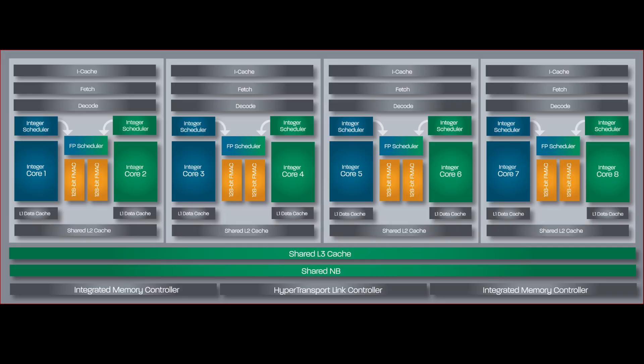To give you guys a better idea of how the module design works in contrast to a traditional CPU core: essentially you have one floating point unit that is divided between two CPU cores, meaning that on our FX4100 we have two full cores and two partial cores. It's kind of like a mechanical hyper-threading, although none of this is really mechanical — it's just at the hardware level as opposed to the software level.